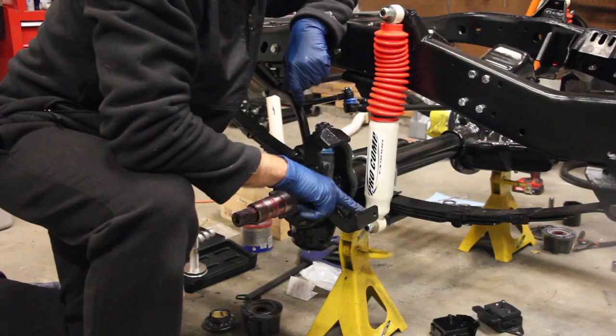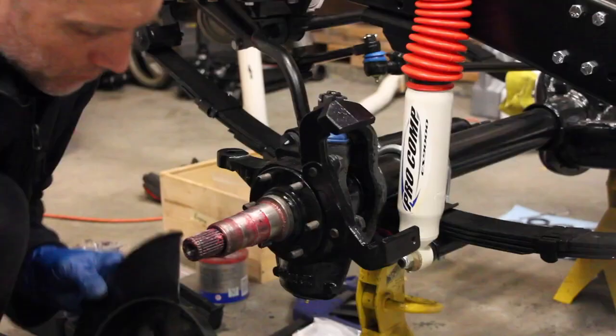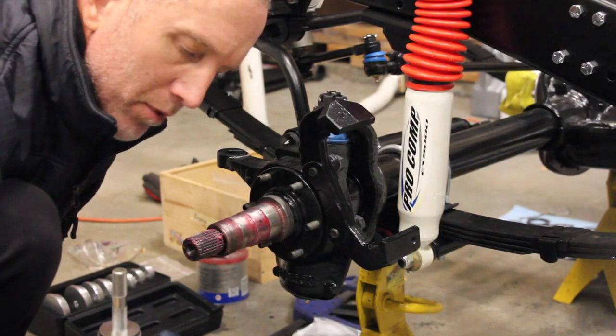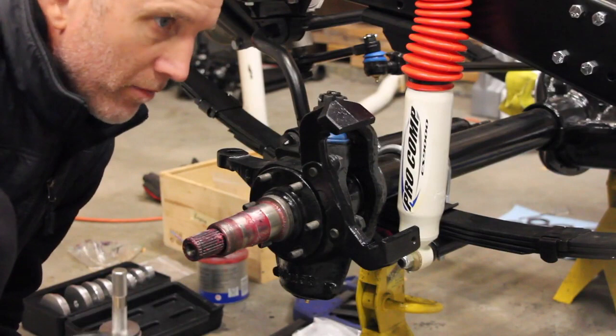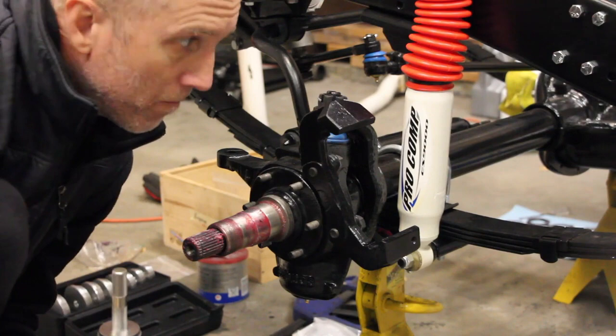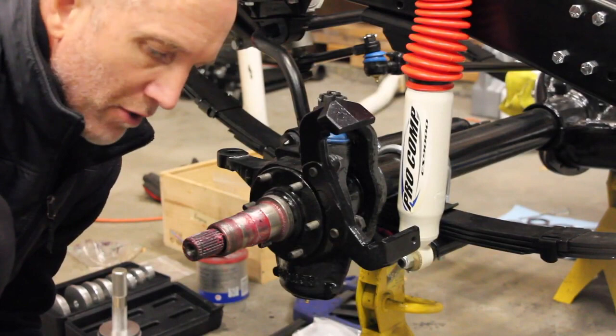The reason I mentioned where the slide key goes is that there are no markings on the caliper anchor support to indicate which side it's supposed to go on. Now for the dust shield — the dust shields are stamped with what side they're supposed to go on; this one has an R and the other has an L. My understanding is that orientation is from the driver's perspective, so the driver's side is left and passenger side is right. For whatever reason, though, it doesn't fit the way you'd expect.